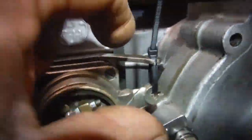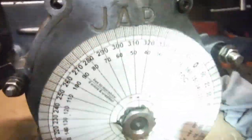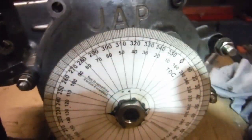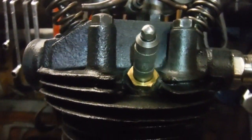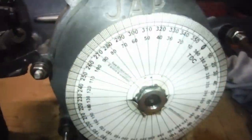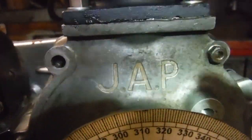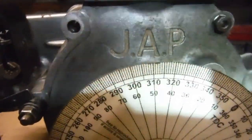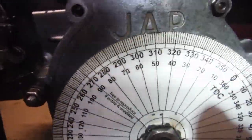What I've done is cable-tied it up into the fully advanced position. I've got my degree wheel on the crank, and I've also got a plunger in the plug hole so I've been able to zero the degree wheel — checking that 40 degrees either side of zero gives equal amounts of piston descent. I'm using the peak of the capital A in the middle of the JAP logo, lining my pointer and degree wheel up with that as a reference.